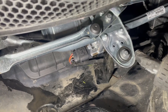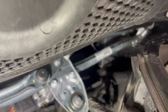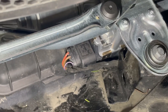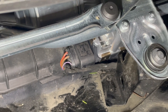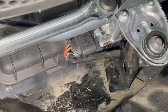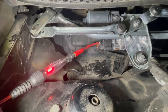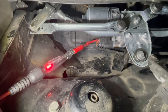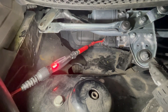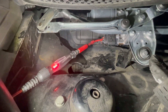This vehicle's been to another garage and they've fitted a wiper motor - brand new, genuine Audi one, see the badge there - that wouldn't have been cheap. There's the connector, three wires: a red and brown, a brown, and a purple and white. The red and brown is going to be power, so we'll stick a test lamp on that - and as you can see we've got power. Now swapping the test lamp tail onto battery voltage to check the ground - and it's lighting the test lamp, so I'm happy we've got a ground to this unit.